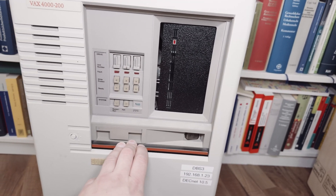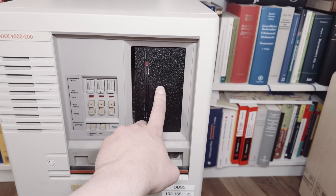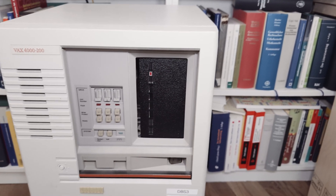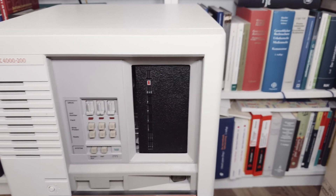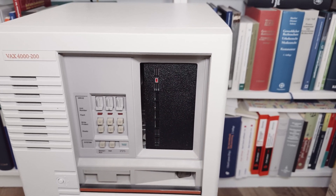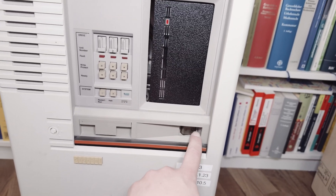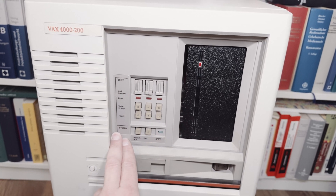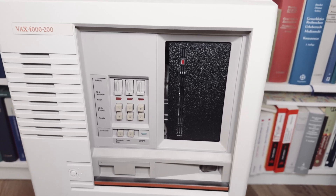Here's something you can open, and behind that there is a hard drive — a SCSI hard drive. It's original to that machine but it's disconnected, so it's not in use; it's only there to fill the space. You saw in my intro that it was empty for quite a long time, and I hope to find maybe a TK70 or something like that to put in there. Here you can turn the machine on or off, and here are the configuration settings for the DSSI hard drive. So this is a SCSI hard drive, but there's also a DSSI hard drive inside, which you will see later.